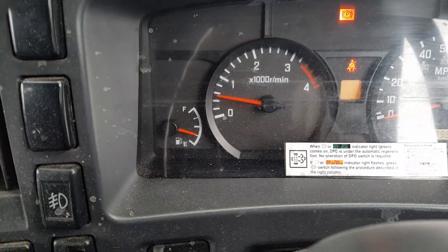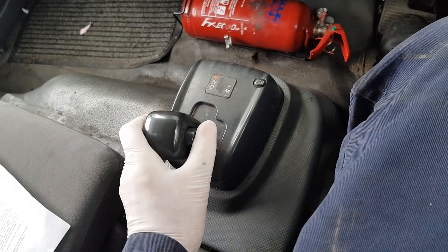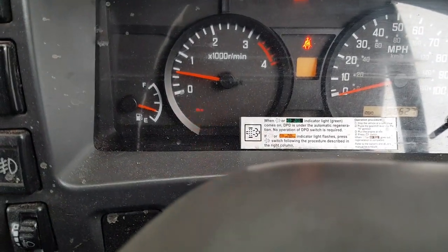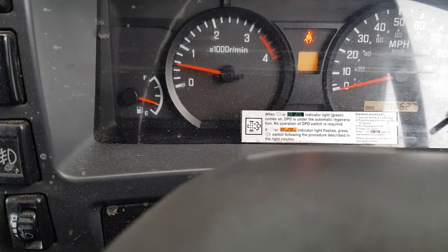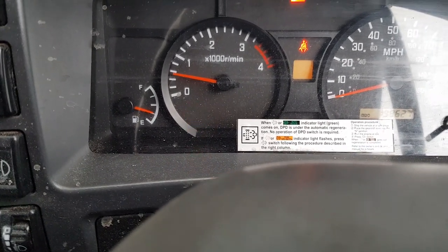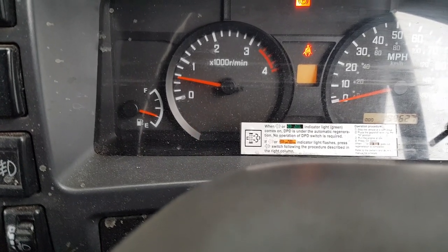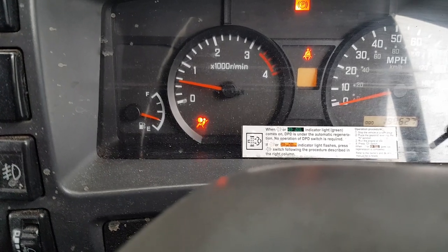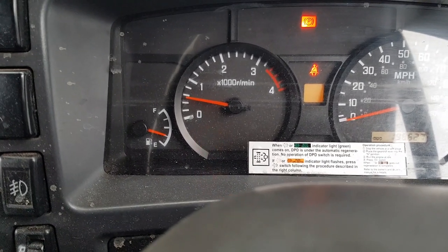Once you get the light doing that, select drive, then second, then neutral. The beeps change, and then with the engine still running you'll hear the gearbox clunking and clanging as it goes through the process of resetting itself — you can hear it bang and click. Leave it alone and keep your foot on the brake. Do not let your foot off the brake and it'll go through the full sequence.